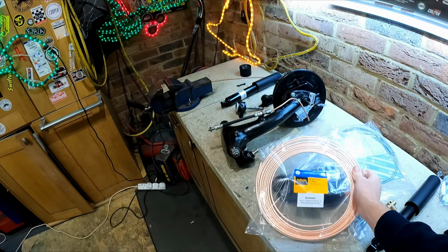Right, so that's the front to rear pipe run now. I have left lots here, because obviously I'll get the subframe back in, then you need to bend it around the subframe and go into the union, so I've got lots and lots to spare. So no worries there. It is a bit of a pig to do, laying on the floor, the front to rear, but we're there. It's all clipped in, and where it's clipped in, there's little rubbers which go over the pipe. Obviously, if you get vibration, you can just see a bit of rubber there.